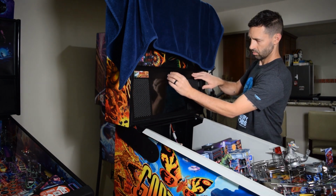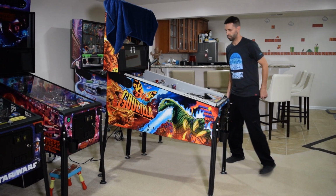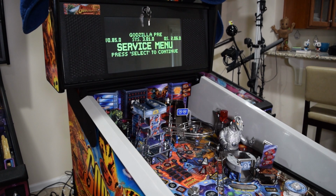After installing the 3-pin connector, completely lower the playfield, raise and lock the speaker panel, plug in the pinball machine, and turn it on. Wait for the pin to boot up, then open the coin door and go into the service menu. For this test, you will want to pull out the white pin just inside the coin door. This will allow high voltage to flow under the playfield.